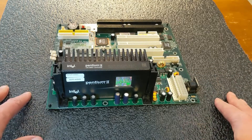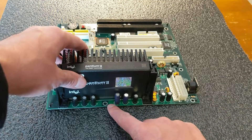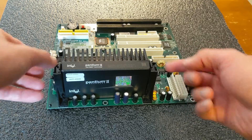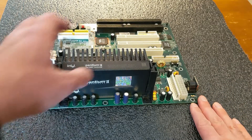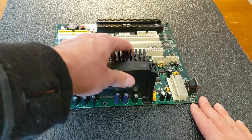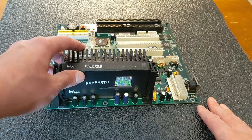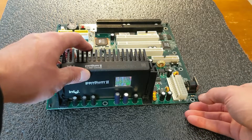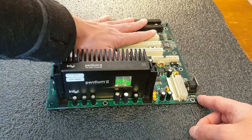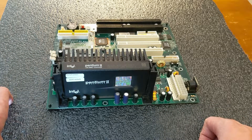If you have the motherboard still in the case, it might actually make it slightly easier since the motherboard is held down by screws. Just make sure these are together and be cautious, but you might actually have to apply a decent amount of force to remove these cards. Try to hold the motherboard in place — you don't want it to crack where the screws are — so put your hand over it while you lift up and out on the processor cartridge.